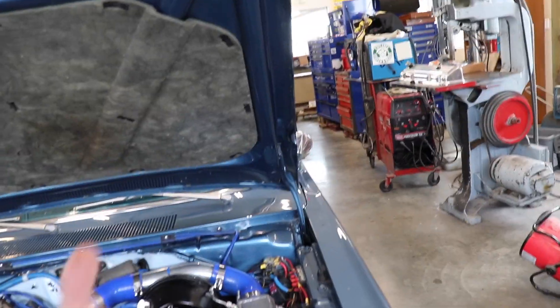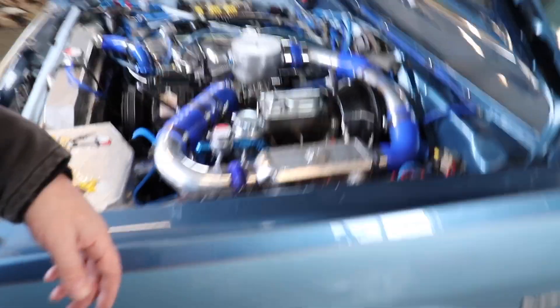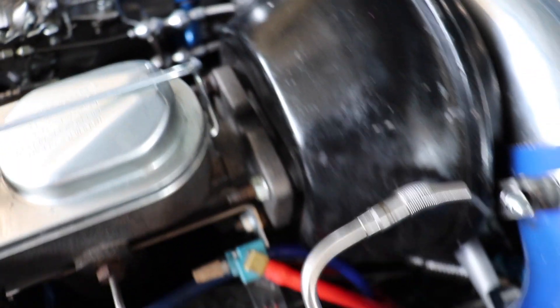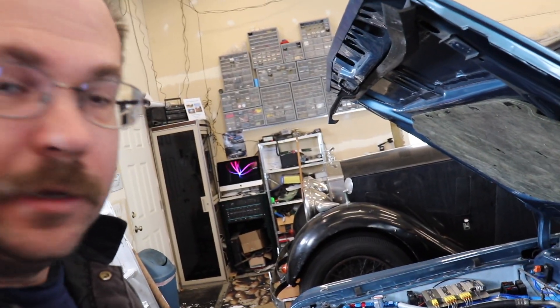The system used to go from this radiator with this little pump, through the intake manifold on this side, came out on this side, and then across the master cylinder, through the actual intercooler, and back through the fender to the top of the radiator. That system worked fairly well, but it was miserable to bleed.